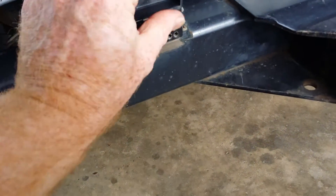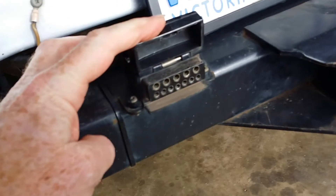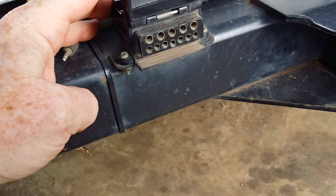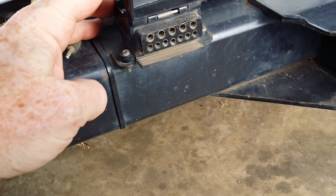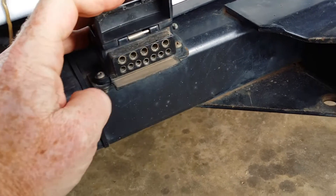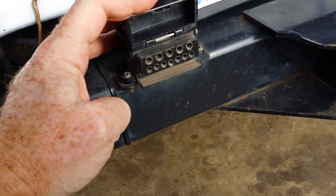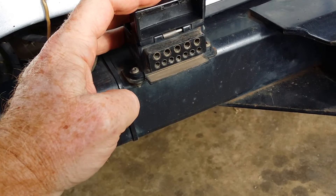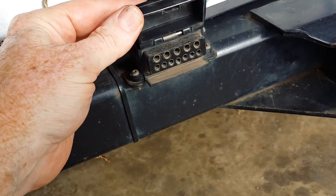Always run a 12-pin plug — that's the best thing to do, because the major power wires have the bigger plugs in the back. You can run a bigger lead, probably four or five mil, down to the auxiliary side of your 12-pin plug — it'll be one of the outside ones. Your caravan manufacturer should have your fridge wired into your auxiliary side as well.